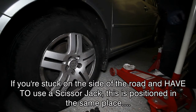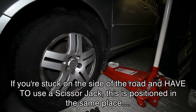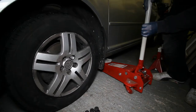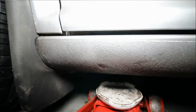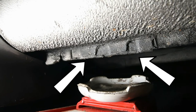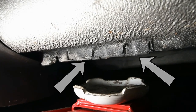Take your trolley jack — it doesn't have to be this size, you can get a smaller one, as long as it can take the weight of your vehicle. Slide it under there. You need to line that up on the sill. Around about here there's a little notch, and that is where the jack should be. If you look underneath, there's a strengthened bit of the spot weld there on the sill, and you'll be able to see exactly where the jack can go.